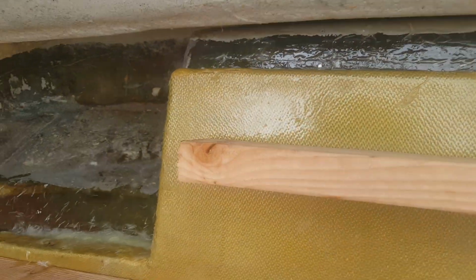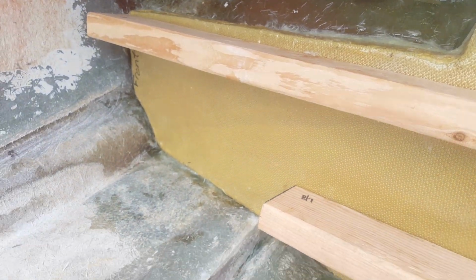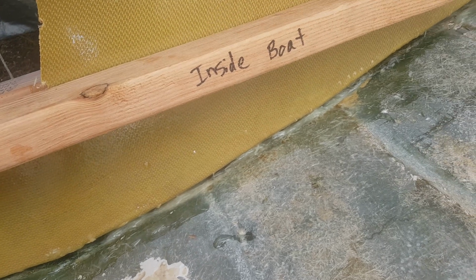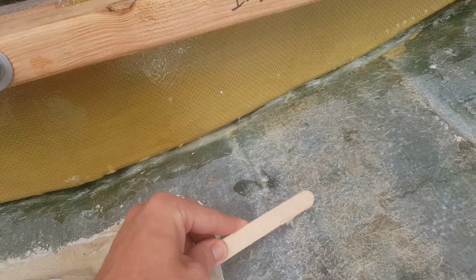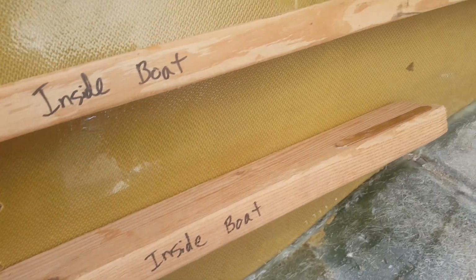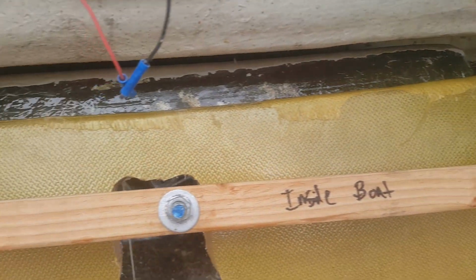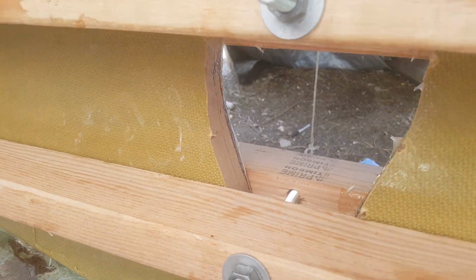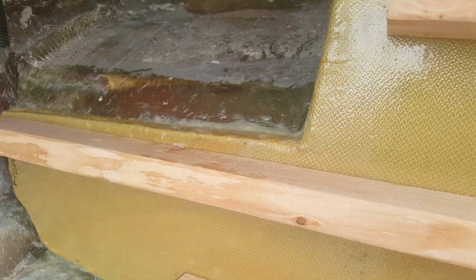But you can see here, I've gone ahead and tightened it so far. It's not completely starting to harden right now, but it is getting close. I went and used my popsicle stick around the edges before I started filming, just to make sure, right? You don't want to leave any spots there, because that stuff is a pain. Anyway, you want to make sure you use a popsicle stick all the way around, make sure there's no weird, wild globs of anything going anywhere, especially in that area where the transom meets the original fiberglass, where the Kevlar does. You want to make sure that's nice.